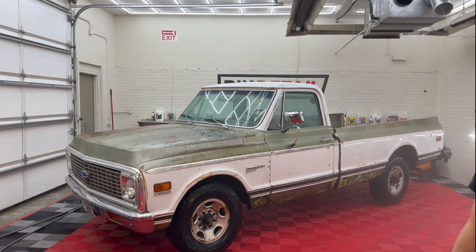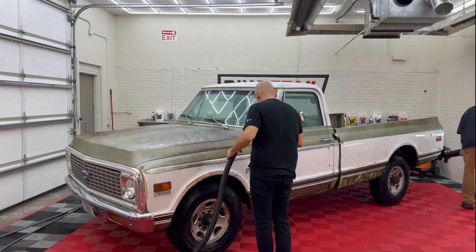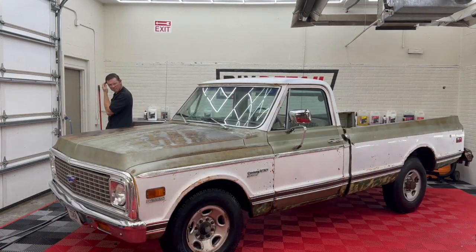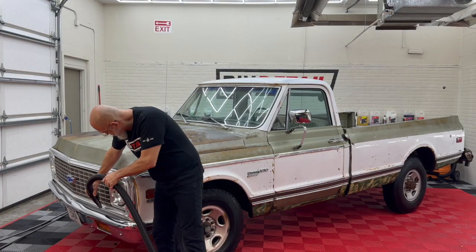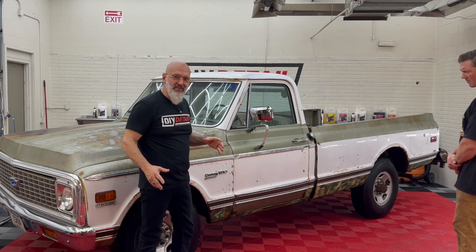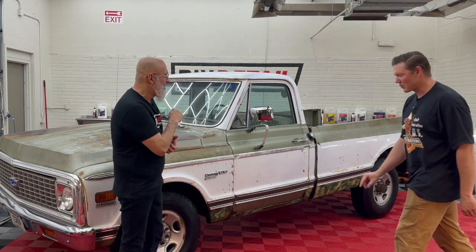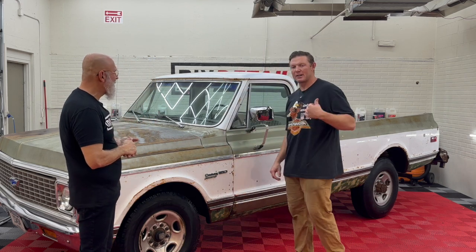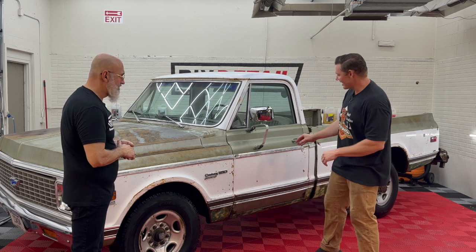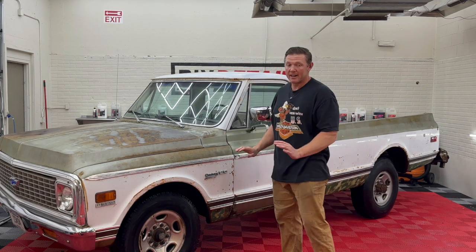Next, we get to dry it with hot air — best way to dry. One important thing to note: we want to make sure we've blown out really well behind the moldings so there's no additional rust that can form there. There's a lot of little clips that hold these on, and those are all inlets where water, moisture, and dirt can get in. If it sits for a long time and repeatedly gets wet and dry, that's kind of where rust forms. If we can get it thoroughly cleaned out, that'll keep this stuff fresh and on the truck for a while.